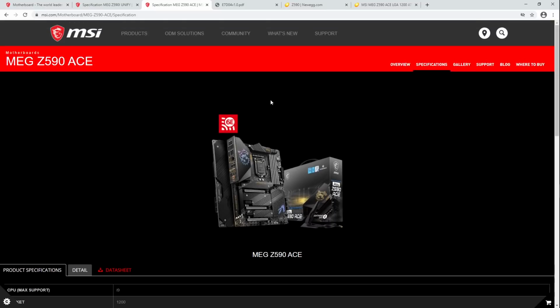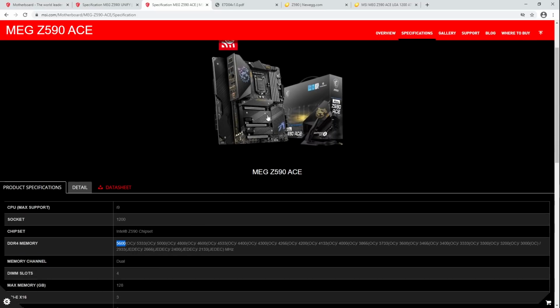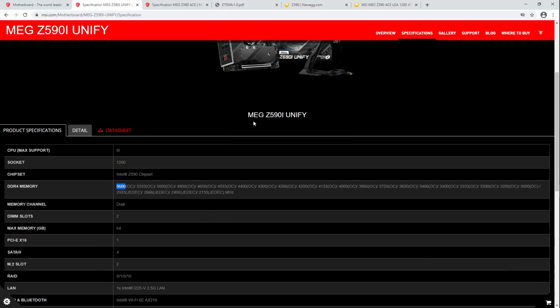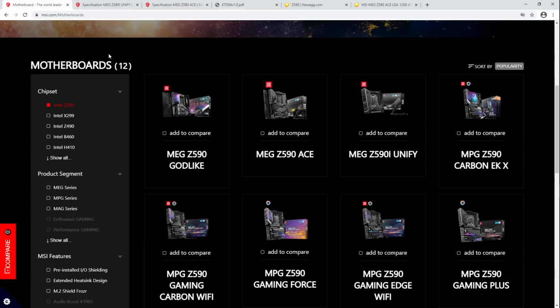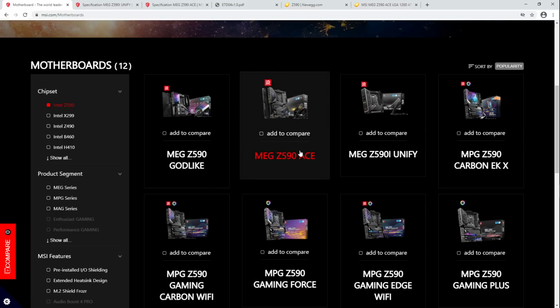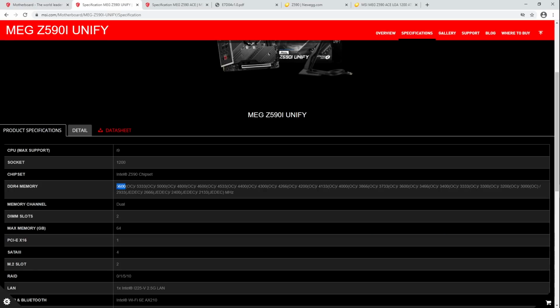And so if they put more effort into getting really solid memory overclocking support on the ATX boards, it wouldn't be too surprising if the ATX boards were actually on par with the ITX boards. But a lot of the time, a good ITX board will just outclock 4-DIMM ATX boards. Or maybe there's just some kind of issue with going past 5600. The next memory ratio that works might be 5800, and that's a really big step.